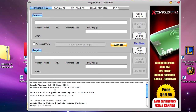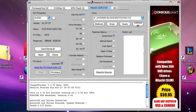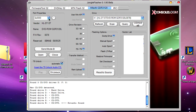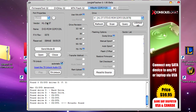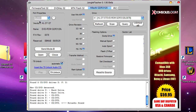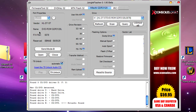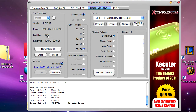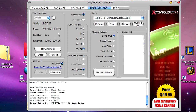Seeing as we're doing Hitachi drives today, it will be quite obvious to go to the Hitachi tab at the top — so let's click that. First of all, go to where it says 'Port Properties' and click the little drop-down menu. Click each one until you find the one that shows some information, kind of like this. Because I'm using the X360 USB Pro that should always be 000... blah blah blah. You should see something like this — all of this should be the same except maybe the firmware version. If yours says 79, then like I said, this tutorial is for all Hitachi except 79, so you're going to have to wait for my next video.